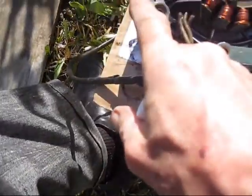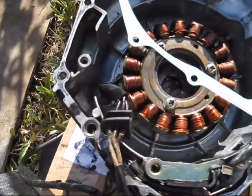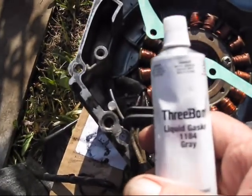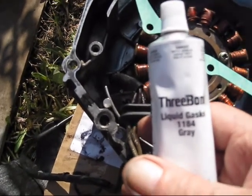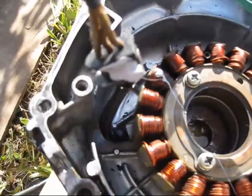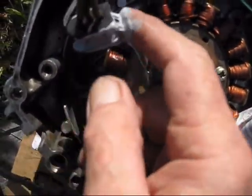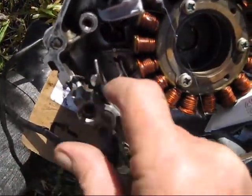I'll have to do this one real good. Then I'll put the gasket on. The trick with this stuff is to put it on nice, even and light. Torque everything down and don't move it till the next day — and you'll never have a leak with this stuff. This looks like the original stuff. I'm trying to hold the camera and do this with one hand, but you want to get it all the way around, then press this into your casing.